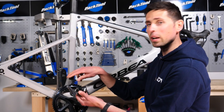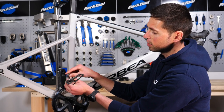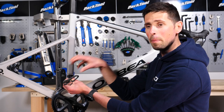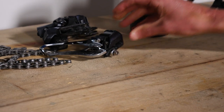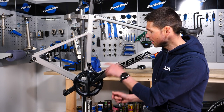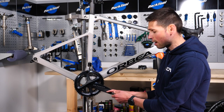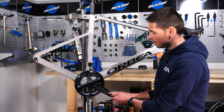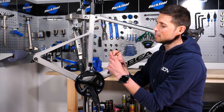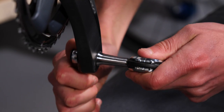Same case again for the front derailleur. When it comes to removing the cable, providing we don't pull on the actual cable itself but use the connector — that's where the strength is, and that's where the tool would normally connect to. Apply a bit of caution and you'll be in no stress at all. Before I remove the chainset, I can look to remove the pedals. Fortunately, these pedals have got an eight mil Allen key fixing on the rear of them. Some pedals might just have a spanner fit, in which case you might struggle with a multi-tool. Happily, this one has an eight mil Allen key fitting.